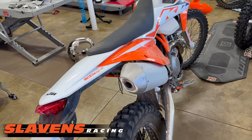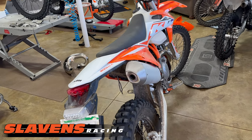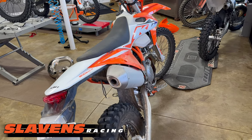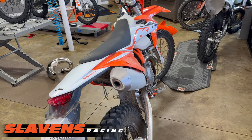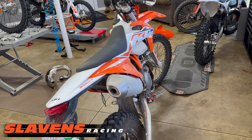All of them make the bike run a bunch better and fix the lean problem. When they're lean, it doesn't just make them run bad, but it makes them run hot. So you're actually reducing your engine life. And if you get it on a tight trail, it's going to run super hot.